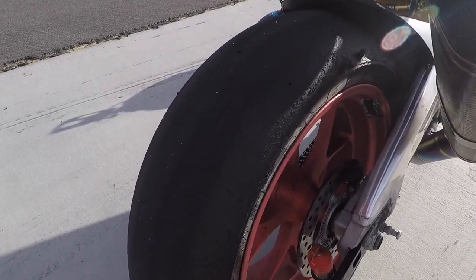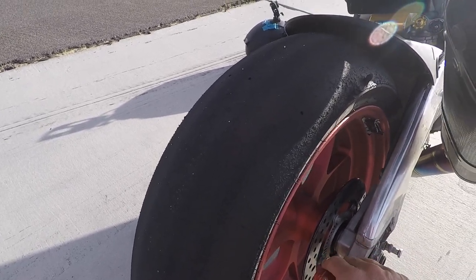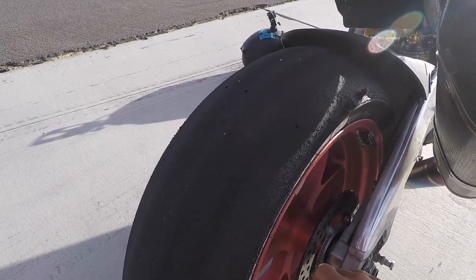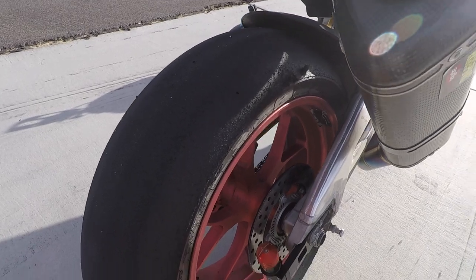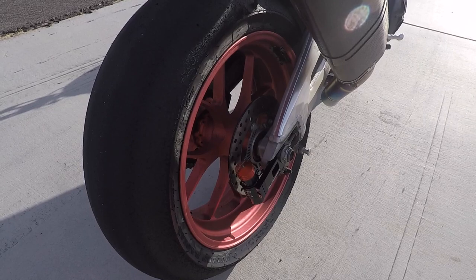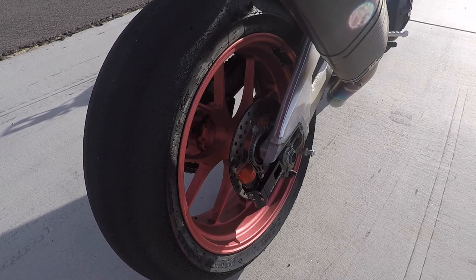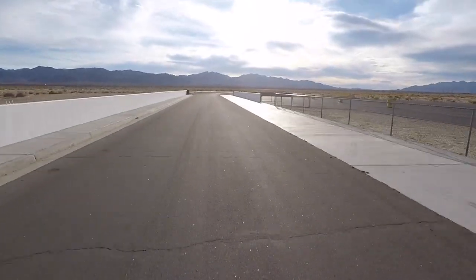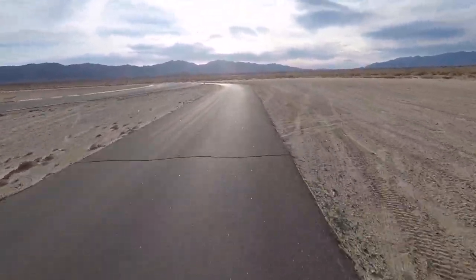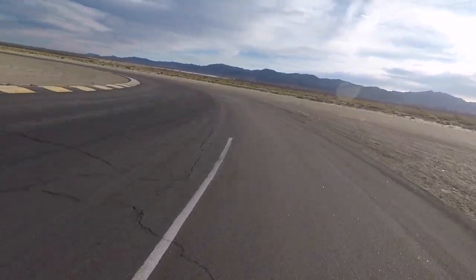So we're at 2 1/4. So let's go 1/2. So that's 3 1/4. And then 3/4 to make it 4, which is 1 from maximum. And based on that, now let's go out and see what we get for any difference in tire wear with no suspension and no pressure changes at all. We'll do another 4 laps and then we'll come in and see what we've got for wear. So hopefully there's a difference.